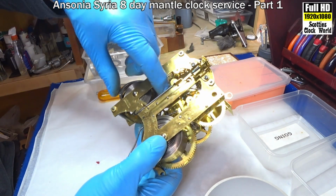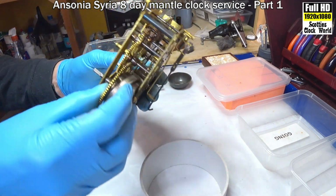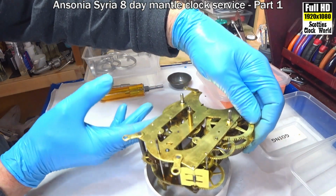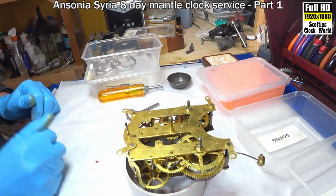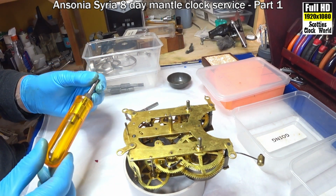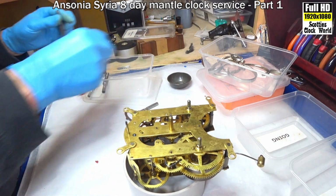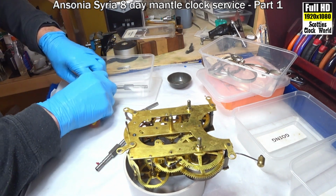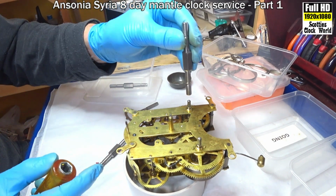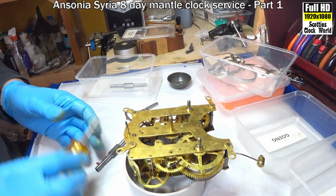Clamp on. Right. It's now loose. So we now need to let the spring down onto the clamp. For that, we're going to need a let down tool, one of those, number 8, more likely to be number 6. We'll see what we got. Alright, near enough.